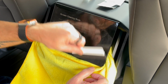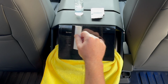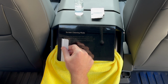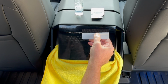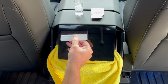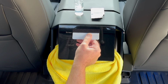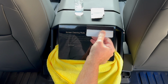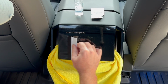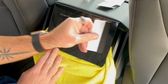Let's work out the last of it. With both front and back, there will still be some moisture sort of retained behind the screen protector, so once you've applied it, just give it a day or two to properly dry off. If you see any little bubbles in there in the meantime, try and work them out, but don't force it because they'll probably just evaporate. But the rear is the same as the front, that you need to make sure you work out as much as you can as you're doing the application.